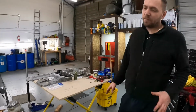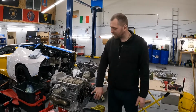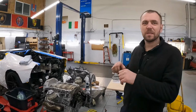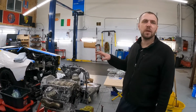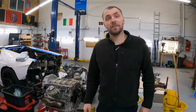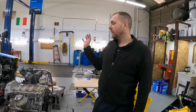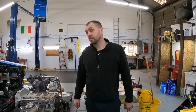Sorry guys. We'll keep working today to assemble the whole engine. I mean, just the casing, pan, and covers. I hope the timing stuff and cams tomorrow, because I want it to dry. I don't want to add lubrication oil and other stuff yet, but for sure I want to assemble what they call a short block. A long block means a complete engine, everything, a finished block. Leave it overnight for drying, and tomorrow I'll install all the wiring and spark plugs, and we're ready to pump.